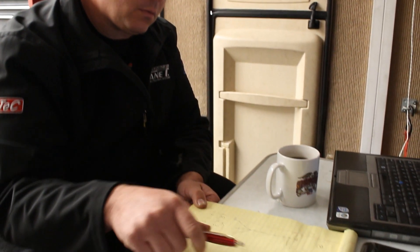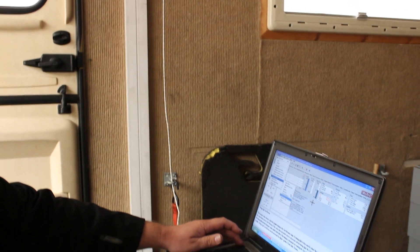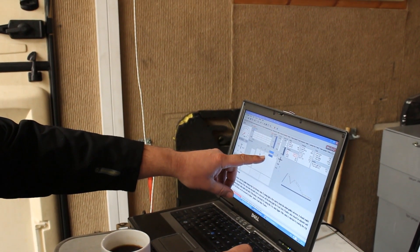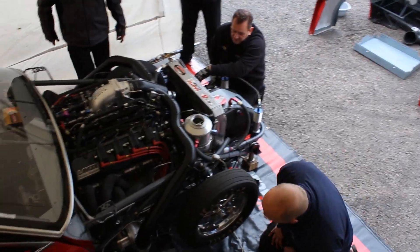I know we have a new cam position sensor, and I thought maybe I was wrong on how I measured it earlier, so let me just move it. I can move it to the other half of the cycle — the engine should start right up. But moving it is the equivalent of taking the distributor out with it 180 degrees wrong and turning it 180 and dropping it back in, only I'm doing it electronically with a keyboard. I did that, and it was no better — in fact, it was just equally as bad, which it should not have been.